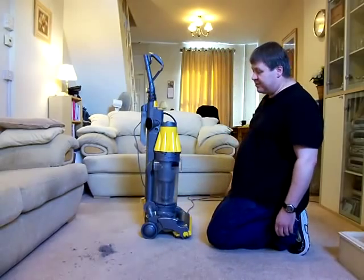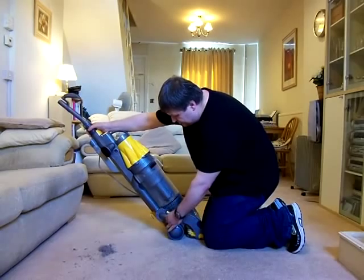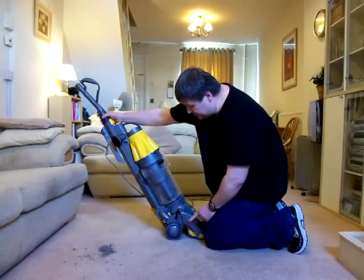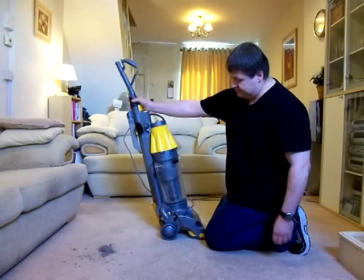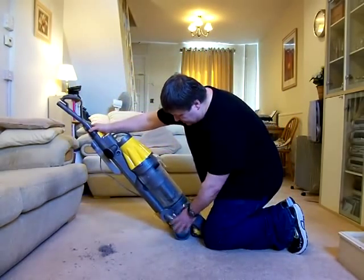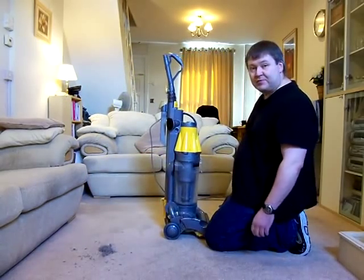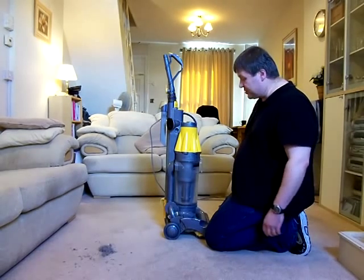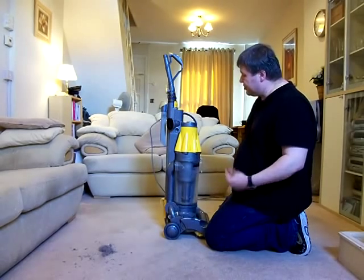And that is how you repair that. So you're reclining it, and all of a sudden you might knock this like so, because it's easy to do when these get worn, and then it won't stand up again. Like that. So again, press that black button in there, slide it back up, and it's repaired. Simple as that. I thought I'd mention that in this video because it's such an easy thing to do when they won't stand up on their own.